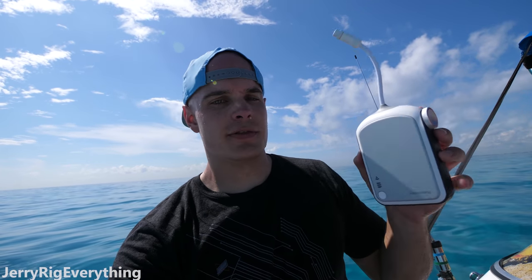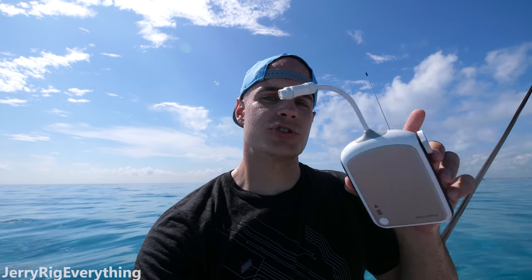This thing right here is called the base station — it's actually like the Wi-Fi emitter, because signals underwater don't travel. Bluetooth and Wi-Fi just don't work underwater very far, so that's why we have the tethering cord. This transmits Wi-Fi into the controller just like the DJI controller does. Data storage for the footage and things is all stored inside the drone with internal storage, so there's no removable SD card slot. That makes sense because the whole thing is waterproof instead of just water resistant — having an SD card slot would have been really inconvenient to waterproof.